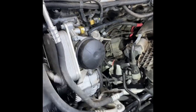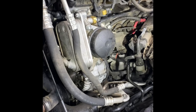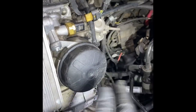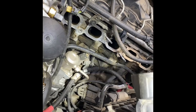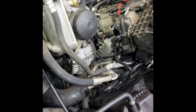Next up I'm going to take this oil cooler off. I've screwed the oil filter cap back on with the wrench just to make sure most of the oil has drained down. This bolt in this area is actually why you have to get the intake back — you don't have to move it that far, just enough to access that bolt. I wanted to get it up out of the way so I have all the room I need to work, and I'm replacing the intake manifold gaskets anyway since this thing has got 119,000 miles on it.